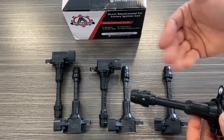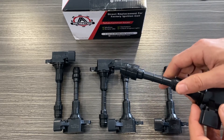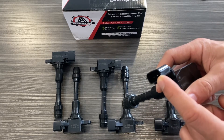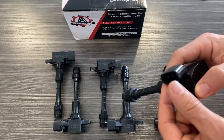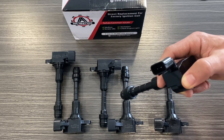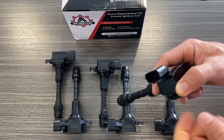It's always a good practice to change the spark plugs at the same time. But you want to make sure you don't see any corrosion or burning on the factory coil. The second thing is, when you connect the electrical connector from the wire harness of the vehicle, check that connector and make sure there's no corrosion, discoloration, or burning. If there is, you'll want to clean that off or replace that connector prior to installing the ignition coils.